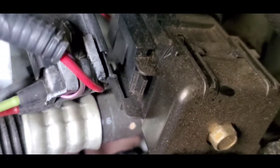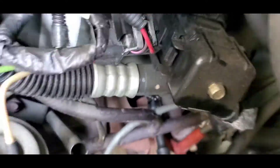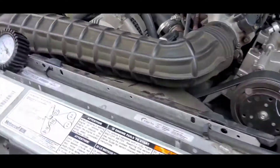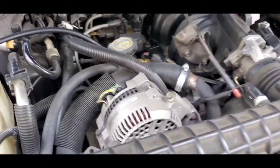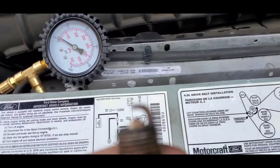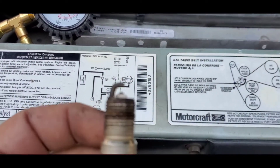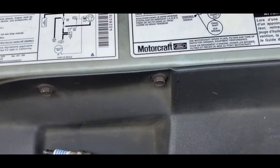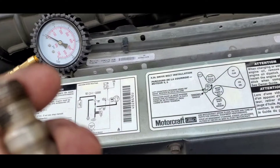This works all the way until the 2001-2006 Explorer. For the other side we do need to remove the tire because it's pretty tricky there. I forgot to tell you guys — when I pulled the spark plug out, as you can see, there's an oil residue on it and the plug was flooded with fuel. That's why the car wasn't starting.